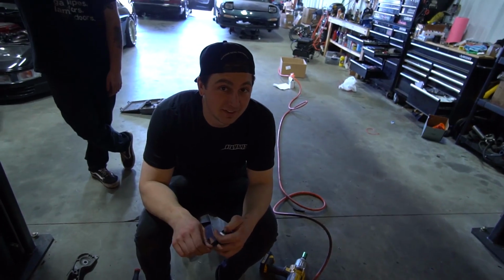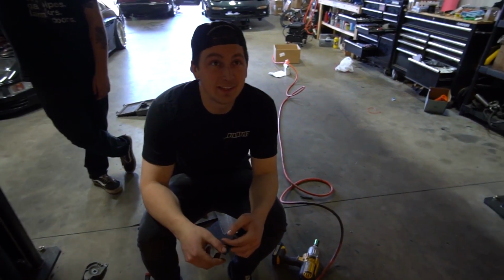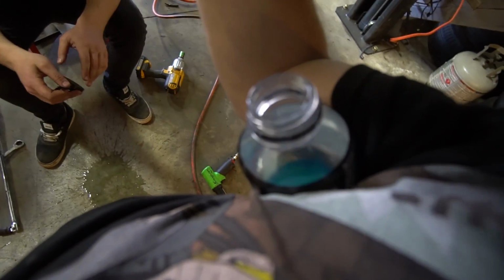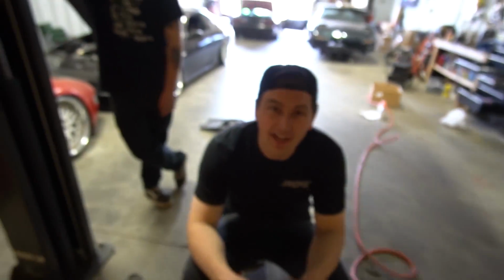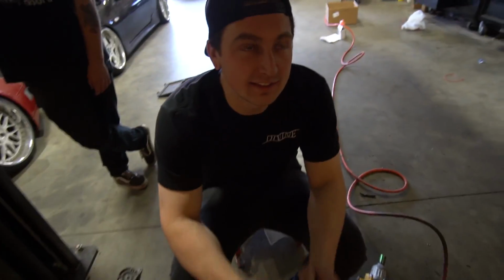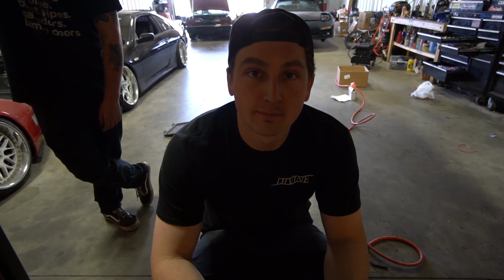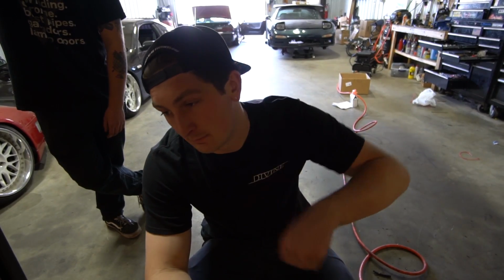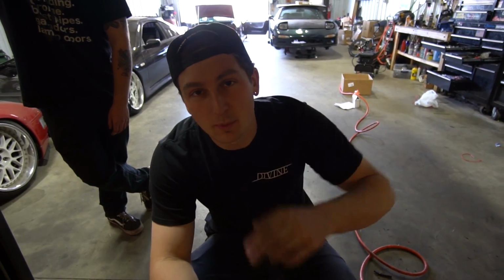That's weird. Well, it didn't work out for me. What didn't? Put my car into gear and it shorted out. Don't ever carry a drink like this. I shorted out my ECCS relay, which is the relay for the engine harness. Something got grounded out of nowhere, which is really annoying. So I'm checking everything, but I haven't found anything yet. So what a pain in the ass, right?